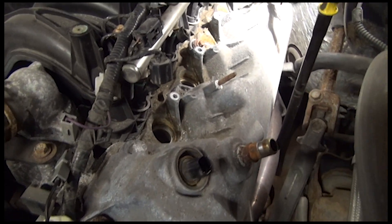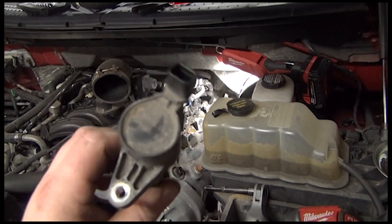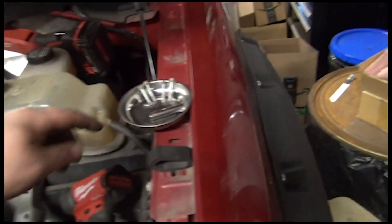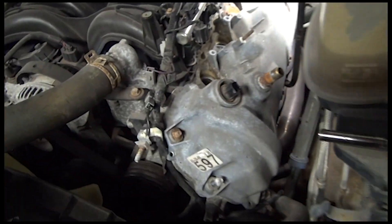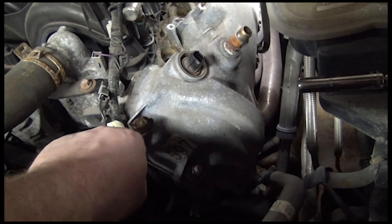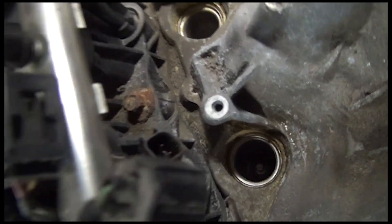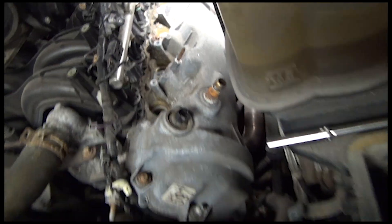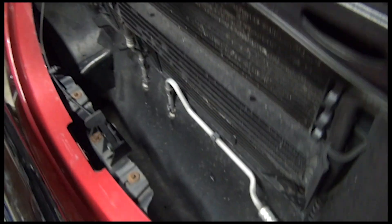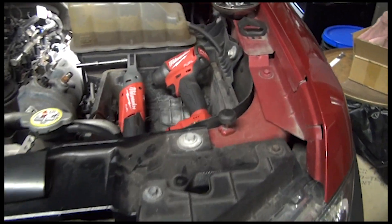To get more room, I pulled the spark plugs out. There are little bolts and they are seven millimeters — that's what I used to get them out. I started pulling these out and these are eight millimeters. It is filthy in here; I've had to use the shop vac on every single one of those cylinders because they were just crud in them. I don't know if this truck was sitting in a flood or what, but so far it hasn't been looking good.